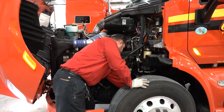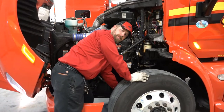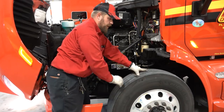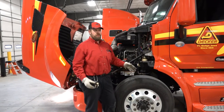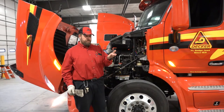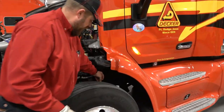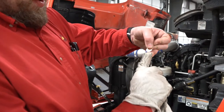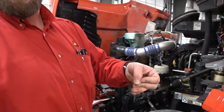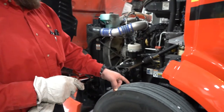Work your way out. Check your rim on the inside for any cracks, damage, or illegal welds. Inside of the tire, make sure your bead is seated properly, and check for any abrasions or bulges. Work your way up to the top of the tire — look for cap separation and proper tread depth. You can buy a depth gauge tester or use a penny. Place it in multiple spots. The top of Lincoln's head is 2/32nds tread depth, which is the minimum for drive and trailer tires. The top of Lincoln's hairline — right where his forehead meets his hair — is 4/32nds, which is what you need for steer tires.